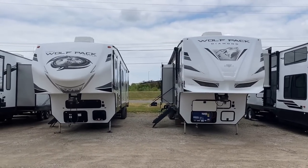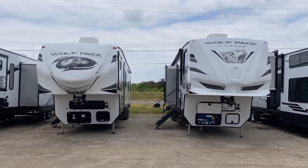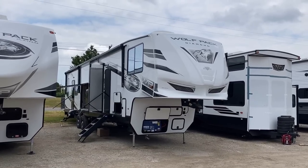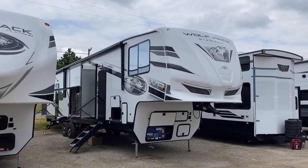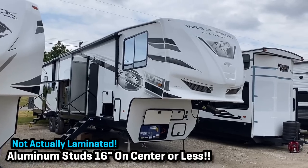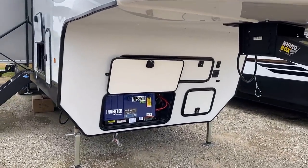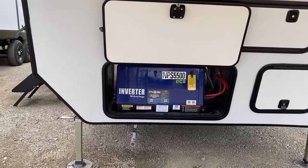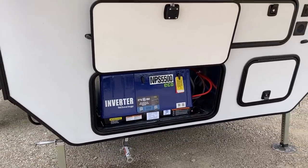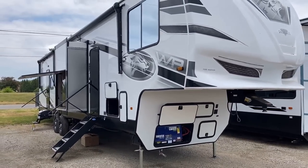It's very obvious when you look at the previous Wolfpack series on the left versus the Diamond Series on the right — we're looking at something a little bit different here. In the Diamond Series, they do everything Platinum does and then some more. They take it up a notch. One of the major things is something you can't see: they are not a stick-built structure like a common Wolfpack. The Wolfpack Platinum on the left had fiberglass skin, but it's still a wood skeletal structure beneath. This is an aluminum-studded, non-laminated structure — I call that good bones construction, like a Cedar Creek or Riverstone. It is exceptionally uncommon in the fifth wheel toy hauler market; I'm not aware of another fifth wheel toy hauler using that style of skeletal structure.